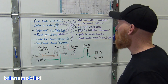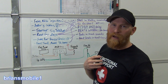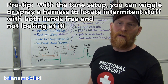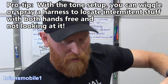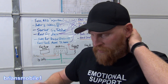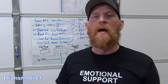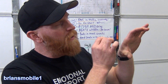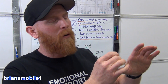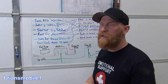One of the fortunate things is when we were able to stabilize in the last video by getting the battery cables stable with a good connection — that helps make it easier to diagnose. If you've got resistance in the positive cable and an intermittent connection in the negative cable, that can cause all kinds of intermittent issues. So if you find a particular signature or ground where there isn't supposed to be one, you can follow it. If you've got a cannon plug with a bunch of different pins, you can scroll through it. Use alligator clips and clip onto it so it holds steady — that's a tip for your diagnostic arsenal.